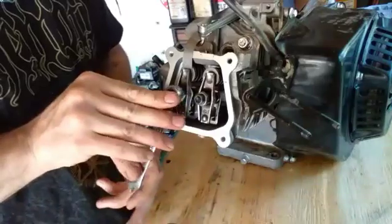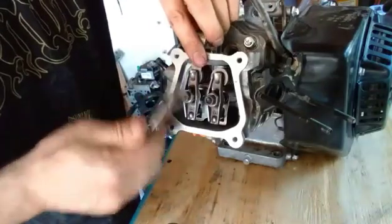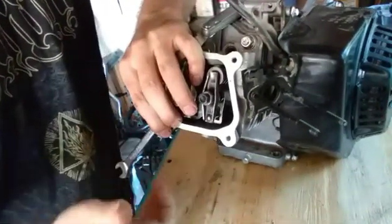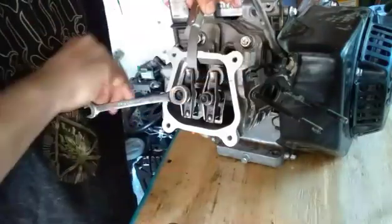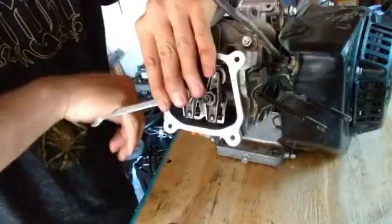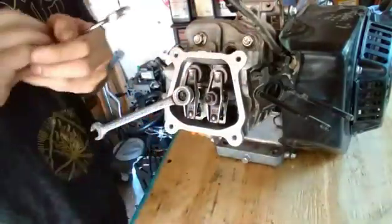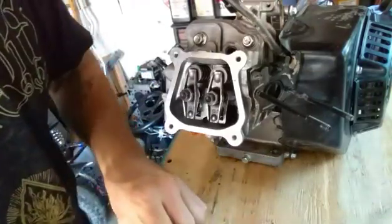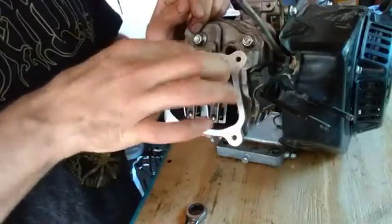It's not liking it — that's too loose. I'll try to get a click or two out of it and it'll be all right. You don't want it tight and you don't want it loose — you want a little drag on it. These things are very, very touchy. Make sure the jam nut is tight on it — we're good. That was your exhaust. You can see a difference in the looseness. Time to do the intake.